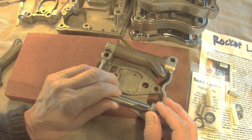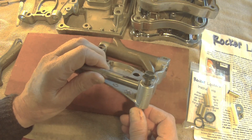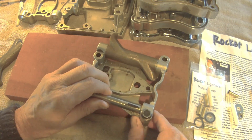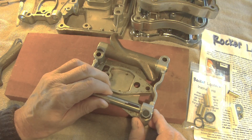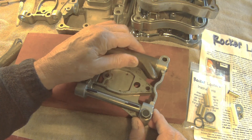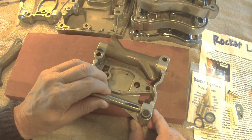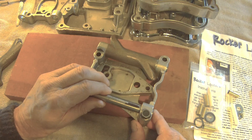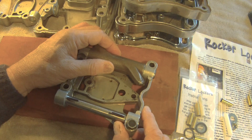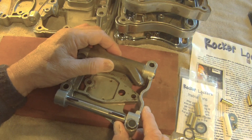Here is the problem everyone is looking for. When Harley designed the rocker arm support plate, they left a gap between the bolt and the rocker arm shaft. This bolt was supposed to lock the shaft, but instead it allows it to rock back and forth. As the rocker arms rotate, the shaft rotates with it, hitting the bolt. This is where the annoying tick is coming from. A lot of times you can see witness marks on the bolts. You're also getting a tick from the end plate, but this is not as bad as the shaft tick.